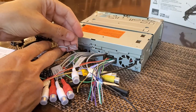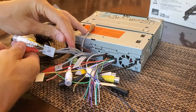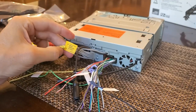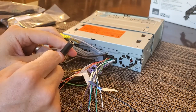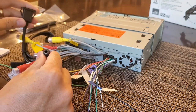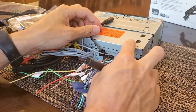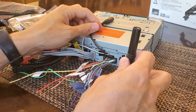This connector is the rear camera input, which I will be using. These come in pairs: subwoofer output, audio input, rear output, and front output. There's also a rear monitor output and an auxiliary input — though that cable isn't long enough as-is and I'd need an extender. There's also an antenna connector; I'll need to buy one since this is a custom build, and they're typically seven to fifteen dollars.